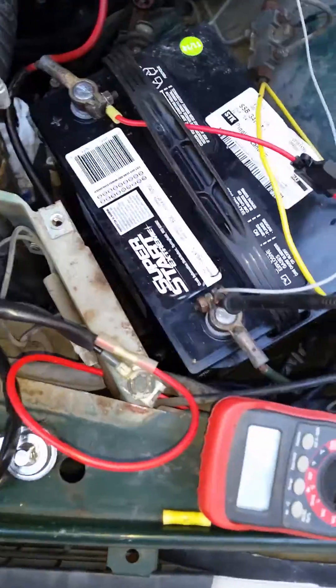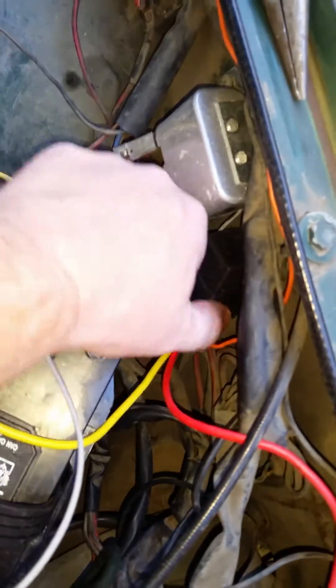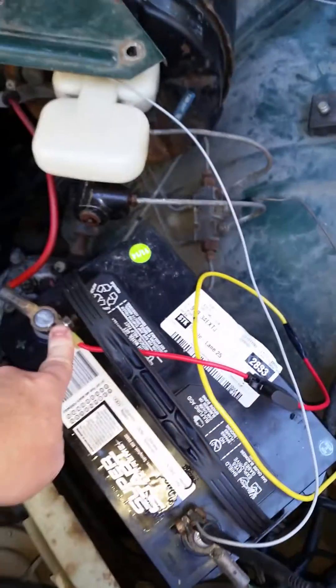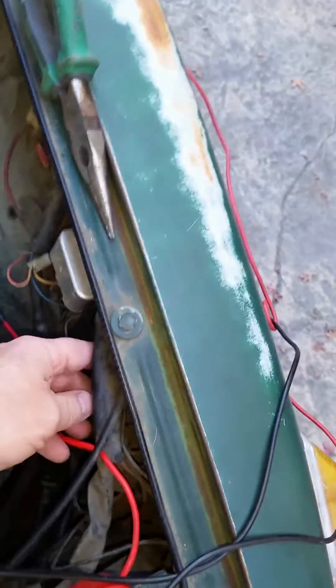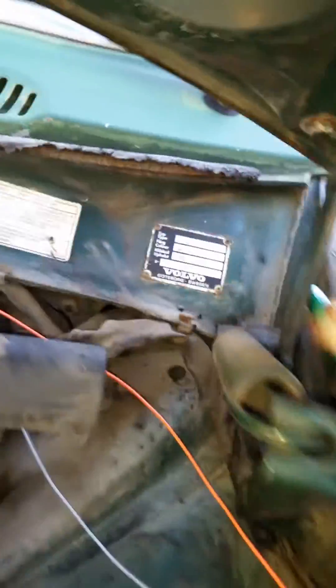With no fan it's pretty simple to wire. There's a ground and a hot wire running over to a relay, which I mounted off of the headlight relay using the same screw. There's a yellow wire which is a power wire that goes over to the positive. I put a 30 amp fuse in line. Then there are two other wires — an orange wire and a gray wire — over here.